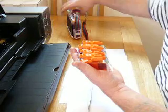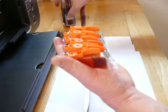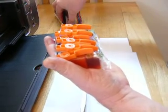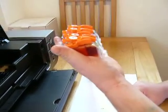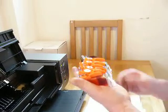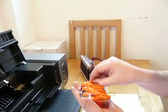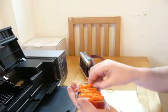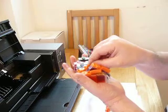The first most important part is the feed roller. Before you start removing the orange caps, make sure this is in the down position. Then you can remove the orange caps. Try and keep the cartridges above the reservoir because if you have them lower, some ink could come out. Remove all eight caps.